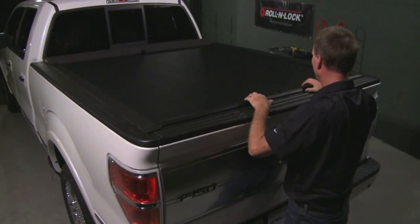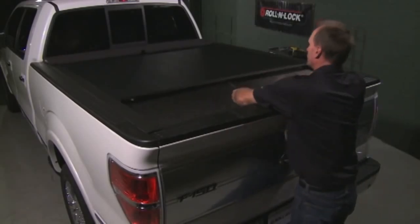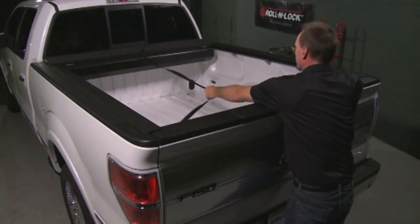To open the cover, pull back slightly on the handle. This relieves the spring tension from the latch mechanism. Turn the lock lever clockwise to the 10 o'clock position. When the cover is retracted, hold the pull strap and allow it to slip through your fingers. The cover must retract with just enough force to rotate and reset the lock lever and latching mechanism.